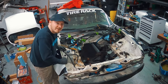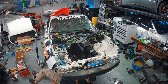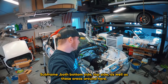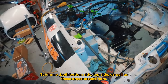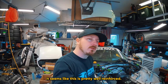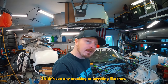Now the fun part — let's start cleaning. Got the front of the car all cleaned up: subframe, both bottom side, top side, as well as these areas around here. Did an inspection, everything looks pretty good for the most part. They did a lot of seam welding. It seems like this is pretty well reinforced and has all the updated brackets and things like that welded together. Subframe seemed in really good condition — I didn't see any cracking or anything like that.